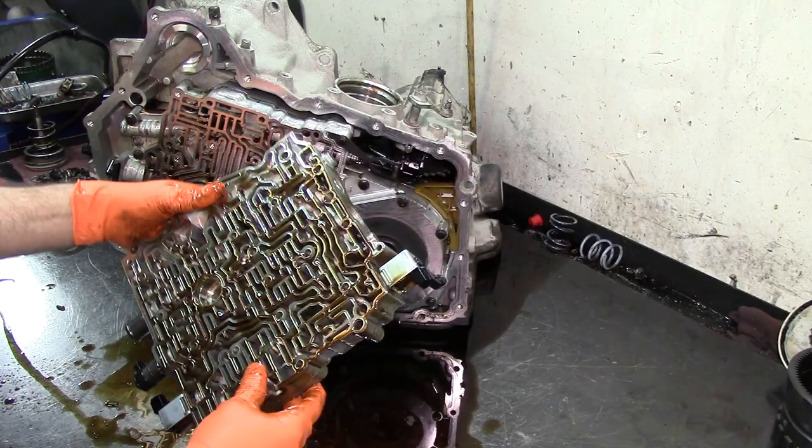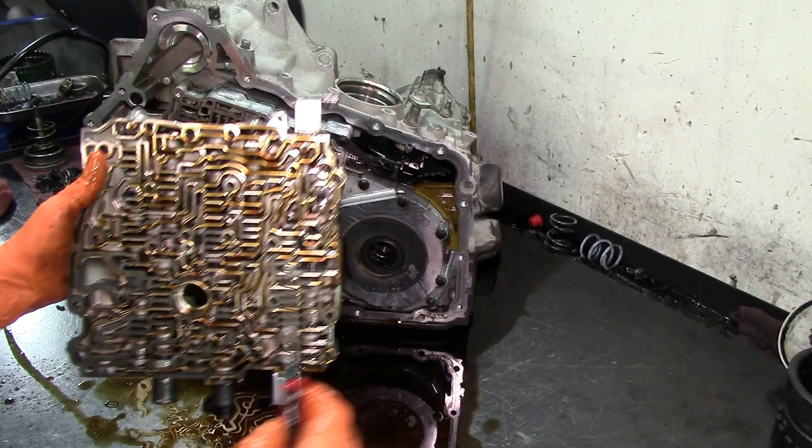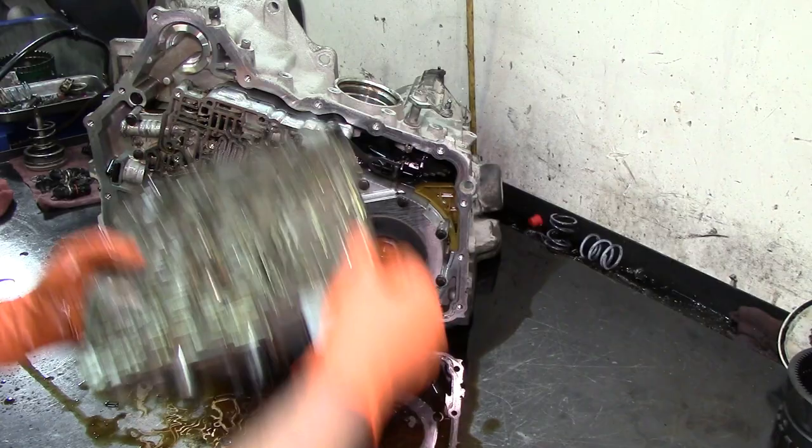Okay, I see that I have a valve completely stroked on the on position, which is this one here. We'll tear down the whole unit, and we'll come back to this valve. Sometimes they get real worn out, and the anodization of the valve falls off, and when that happens, the valve body needs to be replaced.